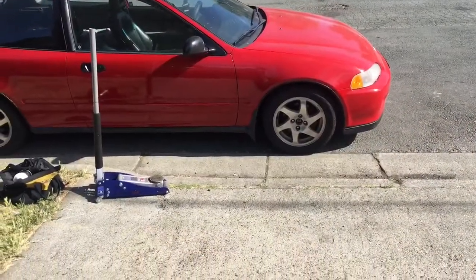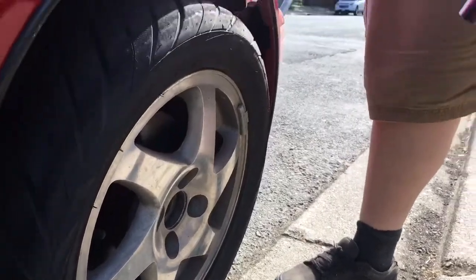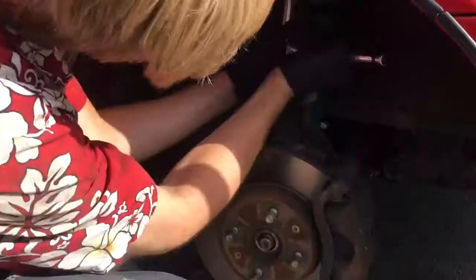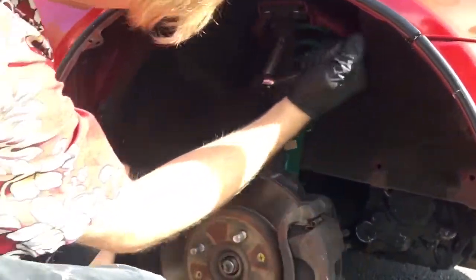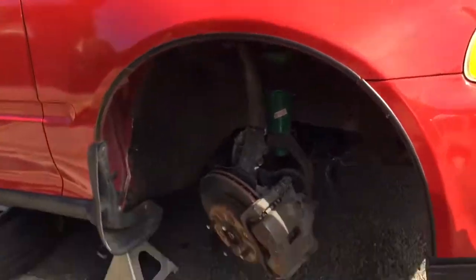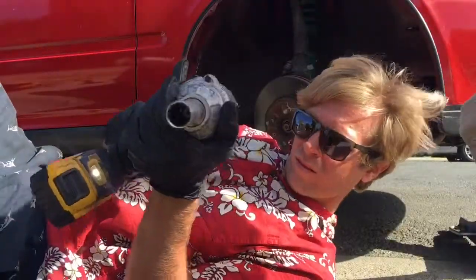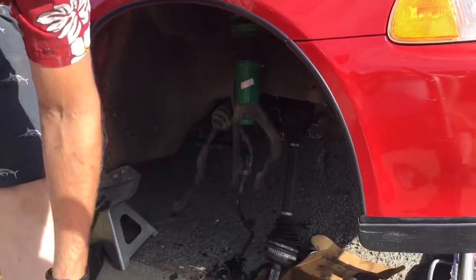We're back. I'm going to jack the car up and take the wheel off. Got the wheel off, it's jacked up — going to take off the axle nut. That thing came out effortlessly, didn't even need a breaker bar. We just gotta take the strut off — the upper control arm's already out, the lower control arm's already out, the tie rod's already out. That's the end of it, it's out of there.